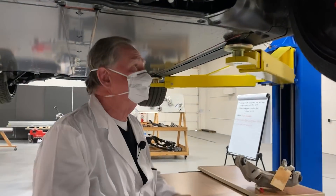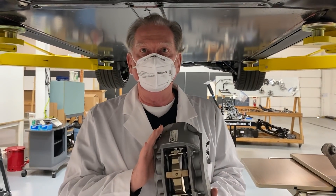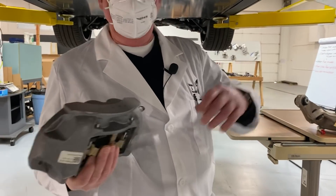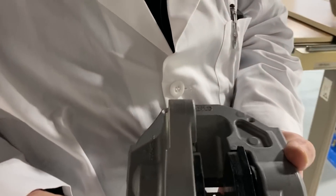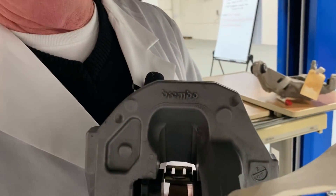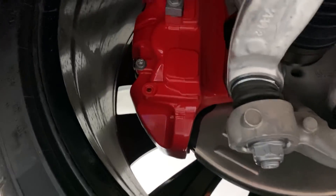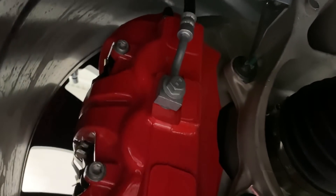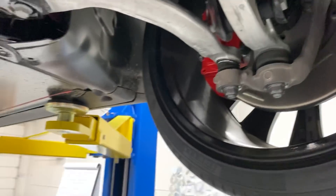Let's move on to something else. This is the Model 3 brake caliper and we know a little bit about this. Tesla basically scrubbed the Brembo logo, but they didn't scrub everything — here we have Brembo on the side. So when we look at this, we're looking at the same sort of fixed brake, but not quite the same. It's much heavier here and this is a cast over, making it quite a bit stronger. We think this is also a Brembo brake — we won't know until we take it apart — but we believe Tesla is taking these brakes and modifying them to make them look like they're part of the Tesla organization.